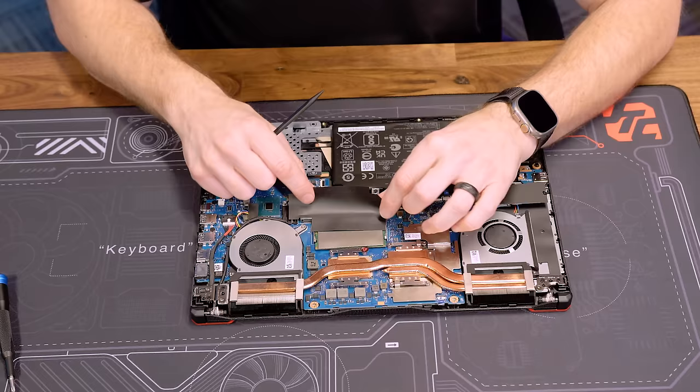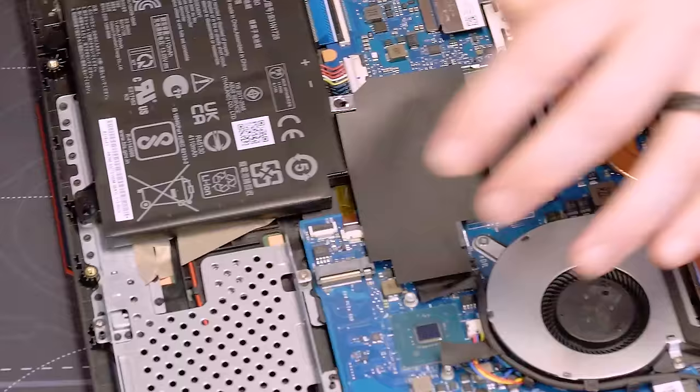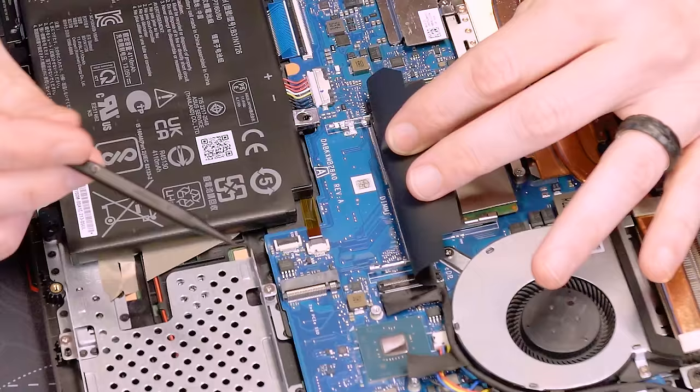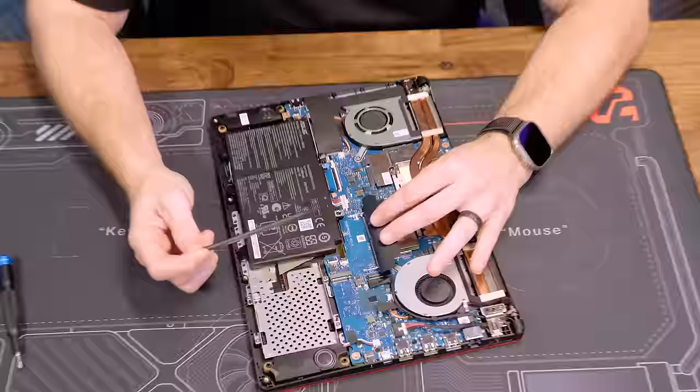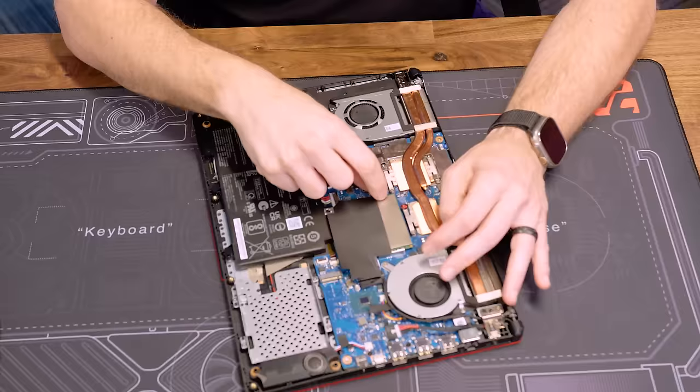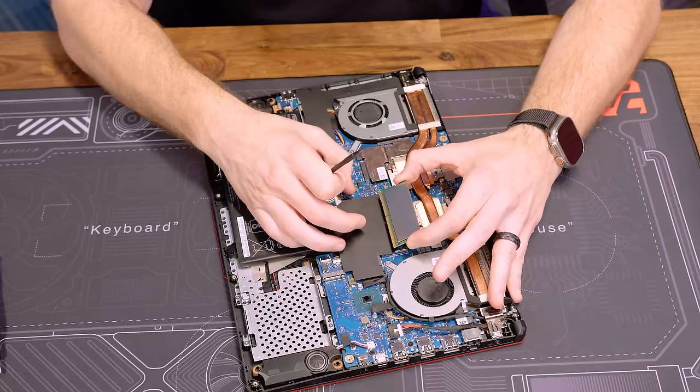We do have expandable memory available to us. This is an 8 GB single stick. We're running in single channel memory right now. So one of the biggest upgrades you could do to this chassis, or this whole setup right now, is to add another stick of matched RAM. They made an interesting cost saving move here by going with a single 8 GB stick, but giving you the ability to upgrade it.